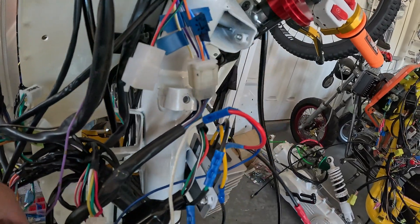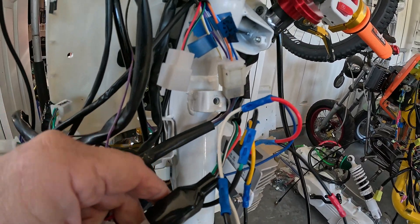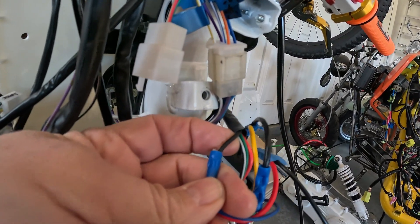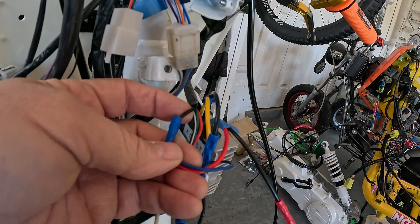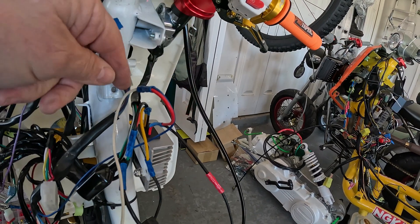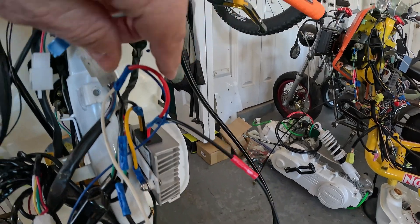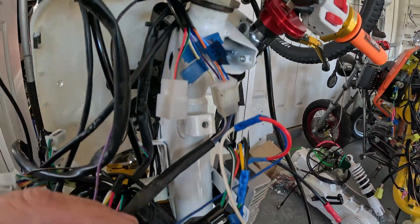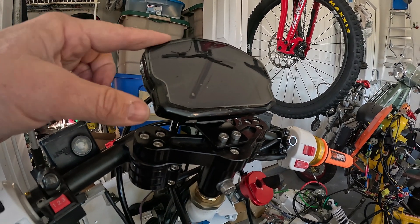This red wire from the big battery goes into that original battery wire — the small one with the fuse on it. That red wire goes into the key switch up here. When you turn the key on, you want three things to happen. It's going to send electricity down the black wire — that's still 96 volts, or 72 volts, whatever your system is. With this black wire energized, you want to turn on three things that are going to require your high-voltage battery. One: you're going to power the DC-DC converter — it's going into the converter, which is already grounded. Here's the power coming in, but only when the key is on.